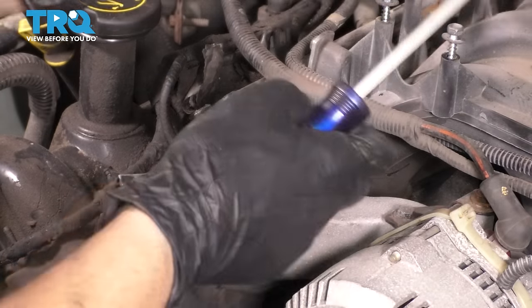You're not going to get it looking new with a razor blade, but you want to get rid of all the raised surfaces. I'm going to clean it all down with gloves on, but then you'll see me taking my gloves off, and that's because I like to feel the surface with my fingertips so I can feel whether there's a slight bump or more debris that I didn't feel. Sometimes you can't feel it through gloves. So on this type of surface, after I clean it up and everything, I like to go over with my bare hands and actually feel for any gasket material or debris that's left.